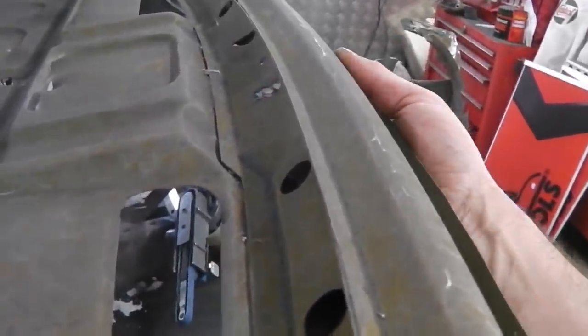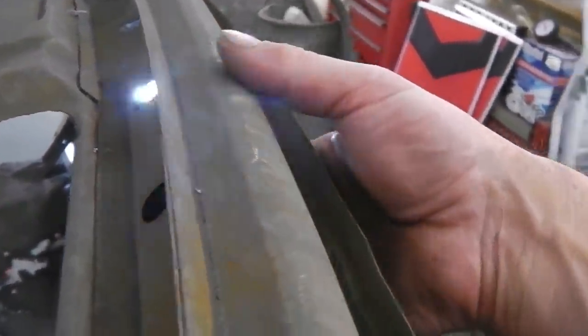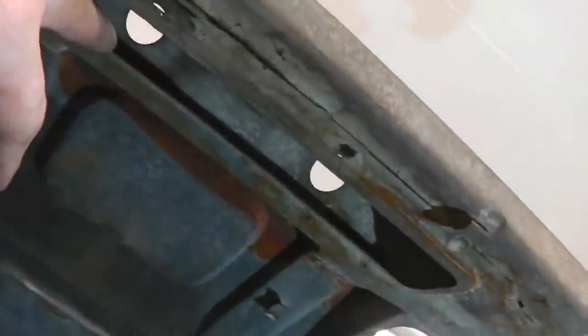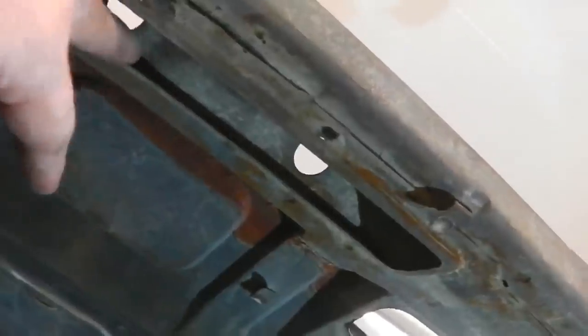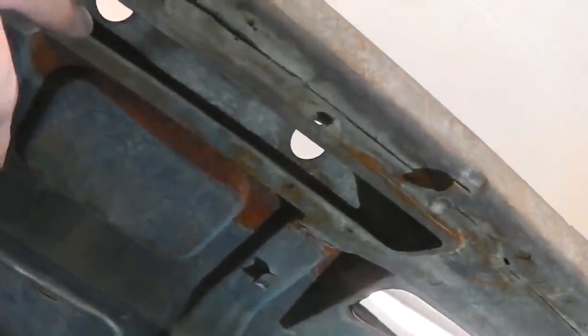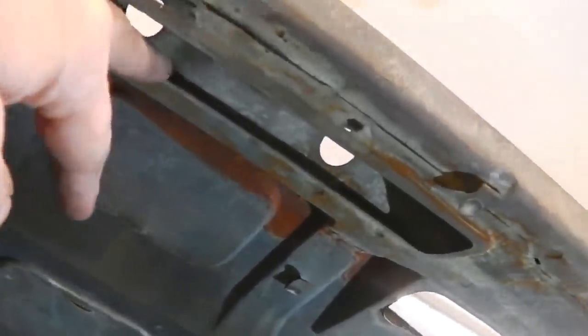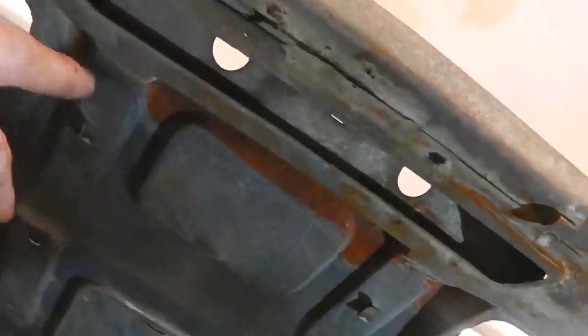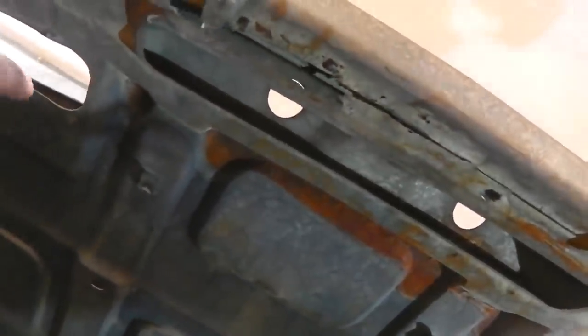Yeah, it is. That third slot's quite well connected into this main structure. If you were to have that slot without it being blocked up, in other words, if this slot's just left as it is now without the box, you're going to lose half your vacuum power, because it's going to be just drawing out of this slot instead of out of the interior of the car. So you've got to have the box fitted on that to cap it and then to pass it on, and it looks like it's just going to convey more vacuum across into the actual car.